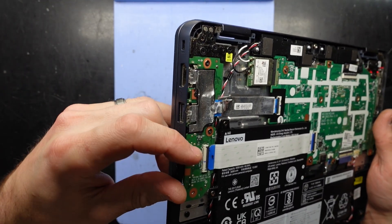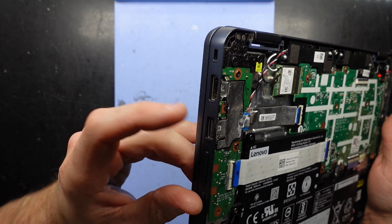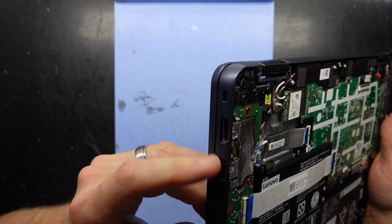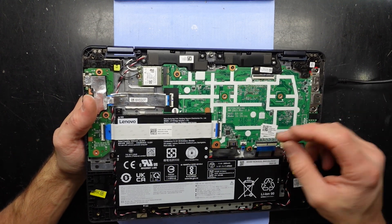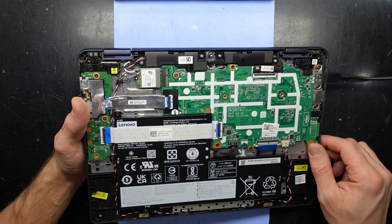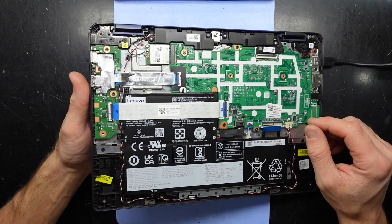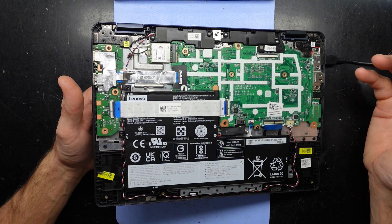So it's very much the corrosion here that was causing all the pins to jump together. I don't know about volume up and volume down, and the USB ports and the HDMI — but I think simply being able to turn it on and use it is going to be a much better outcome than what this previously had. I'm pretty much going to leave it at that, because I couldn't really recommend replacing parts here if we don't know if the device is going to work properly.